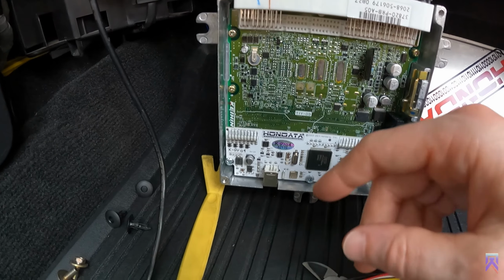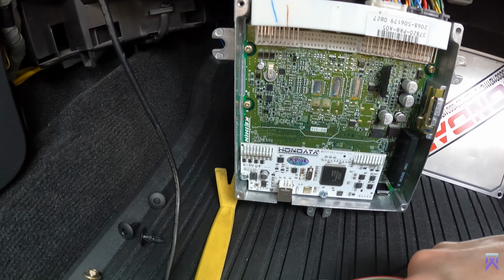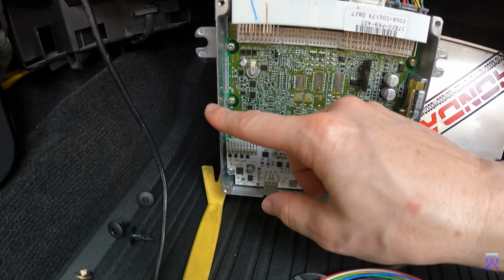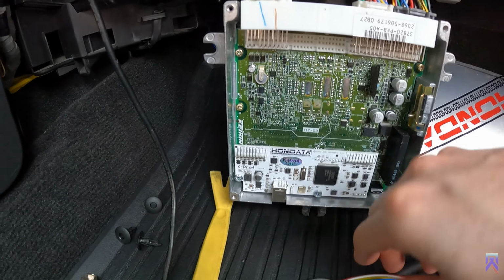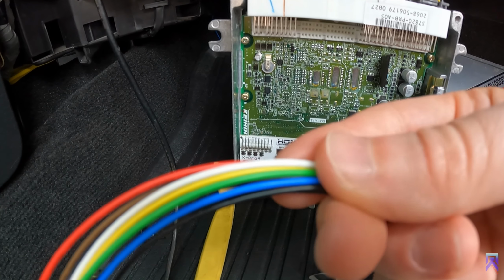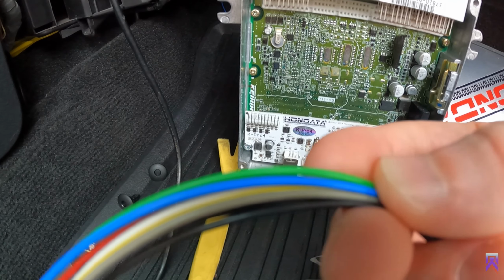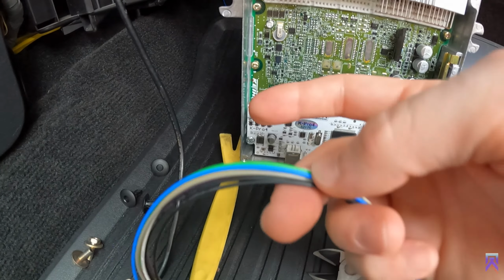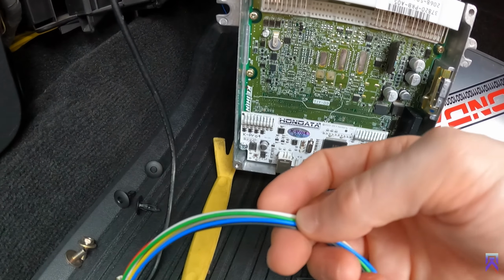And even if you didn't notch it, if you had these in here, you're not gonna be able to get access to them. And you don't wanna smash the wires in between the casing and the cover. So we're gonna have to notch this out to the diameter. So just squeeze them together, look at the diameter of it, and eyeball it up with a drill bit. And I'll explain how I do that in the next step. And I'm also gonna heat shrink where these wires come through the box, just for a little extra protection. So we're gonna go ahead and do that next.